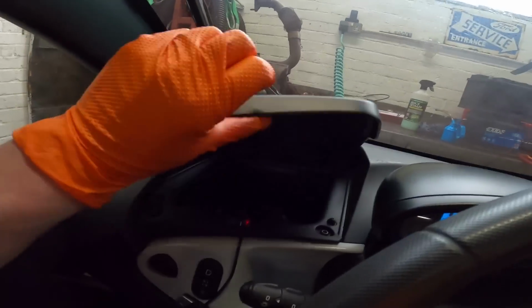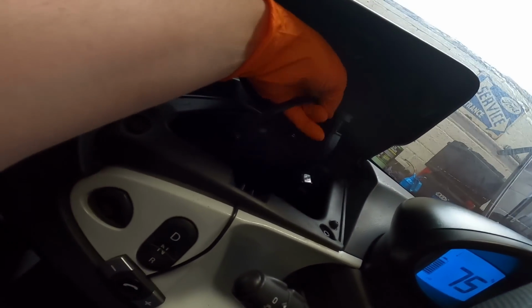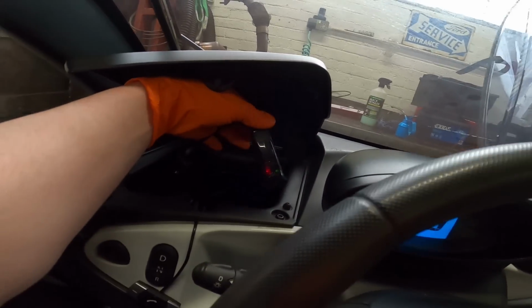The lithium battery also comes with this little box. So this little box here is like an OBD override. It's got a little on-off switch there, so he says if I leave the car sitting for a long period of time, I need to turn that switch off, but I need it on while it's charging. What this does is, as far as my knowledge on EVs goes, and from what he's told me, the standard battery is like 57 volts when it's fully charged, and his battery is well past 60 volts. I think it's closer to 70 volts.